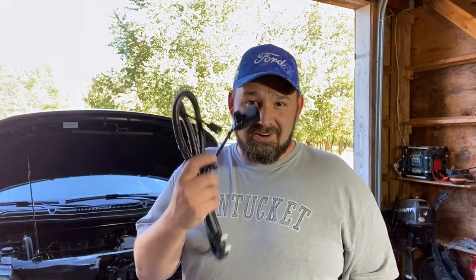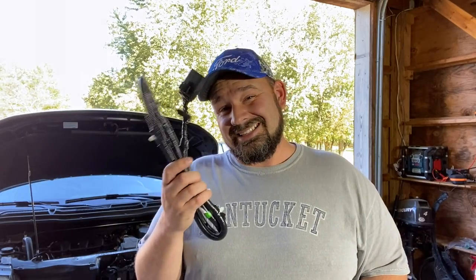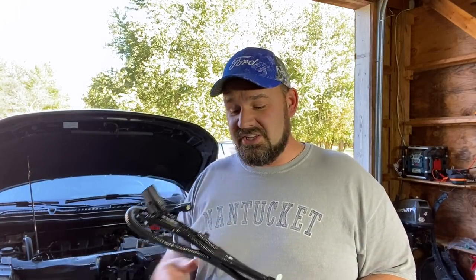It's only nine bucks, and with some help from folks online I figured out where it goes. It attaches to the back of the grille, but I couldn't figure out where the connector plugged in. I searched everywhere and couldn't find it. Turns out I was missing an entire harness — this harness right here. When this thing was wrecked they did a partial teardown, and I didn't get this harness. On fancier versions with front parking sensors that would be built into this harness too, but on this basic police interceptor it's just for this one sensor. When they dismantled it, they took the harness with them.